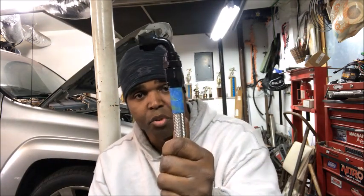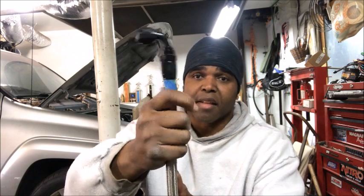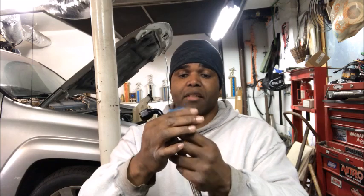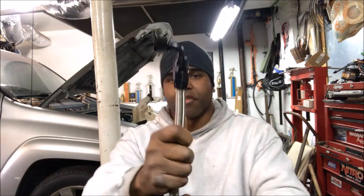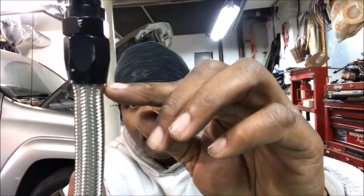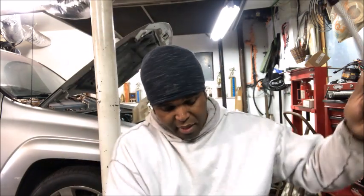You can't see any of the braid between the collar and the tape. But I'll show you something else. Check this out. So let's remove the tape. Another way you can tell if you have a good install, which the way I like to do is, you remember how I showed you how the male end will protrude outside at the back end of the nut? If you see at the bottom, look at the base of the nut. You see how it's bowed out a little bit? To me, that's an indication that it's a proper install, because what's happening is that one piece that sticks out is in the nut and it gets a little tight. So if it bows out like that, to me, that's my telltale way of knowing that the install is tight and good to go.